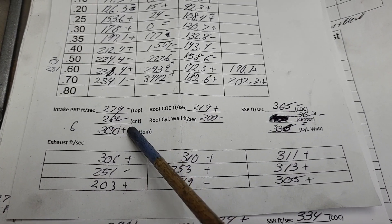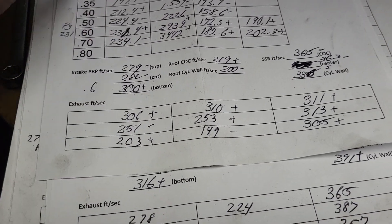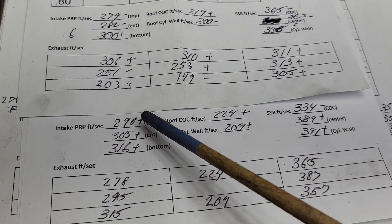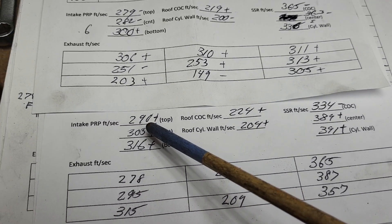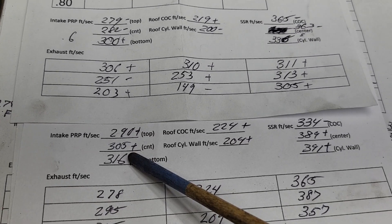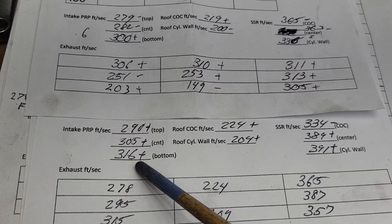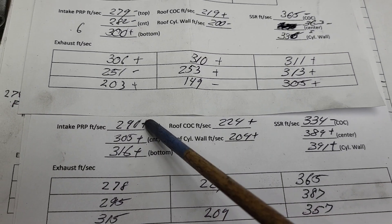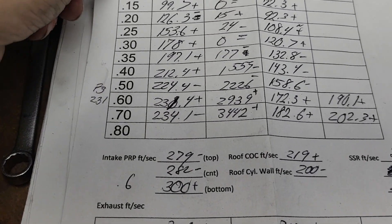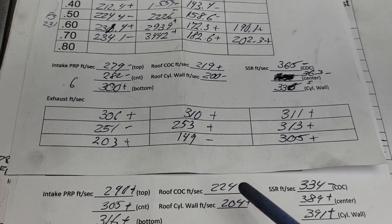That's only 19 apart — I'd like it a little tighter than that. We're not bad as far as top to bottom on our pushrod pinch. When we added the texture to our curve, it doesn't stick to that wall as well. So what does it do to the whole pinch? It speeds the whole pinch up because there's actually less area for the air to flow around — we have that little bit of turbulence, those little ball bearings of air on that curved wall side. As far as flow, this was 231.4, this was 230.4 — only one CFM difference, but big differences in our speeds.